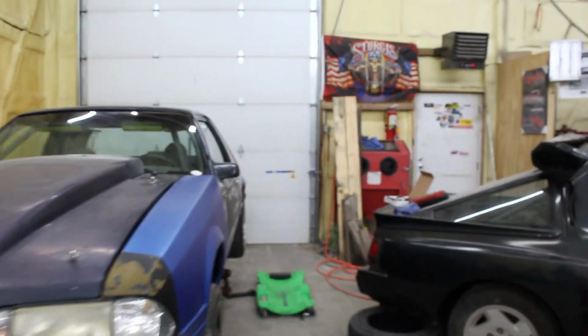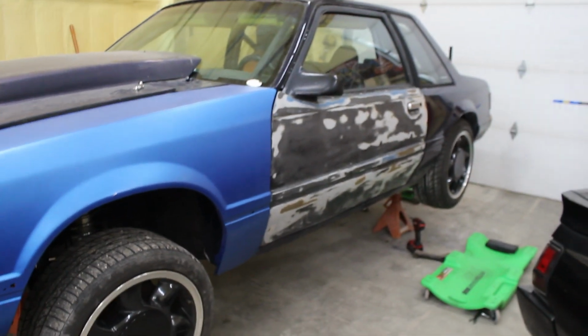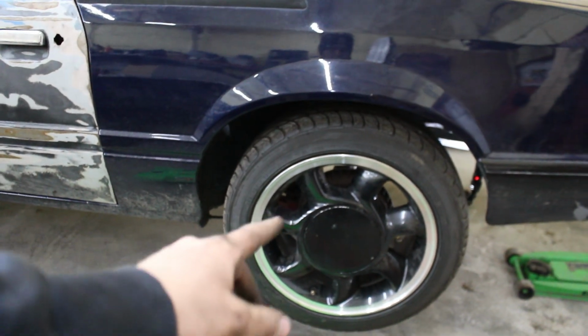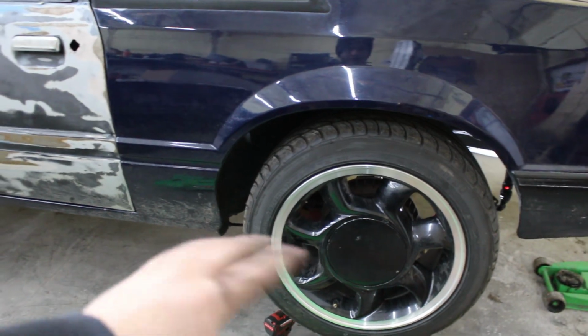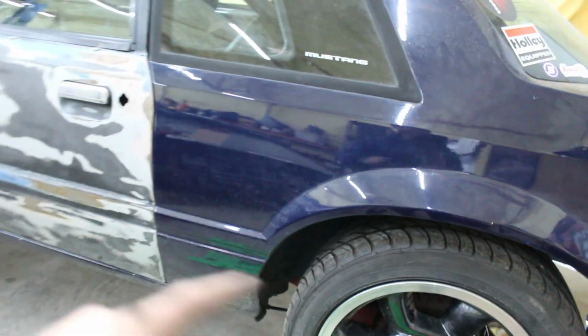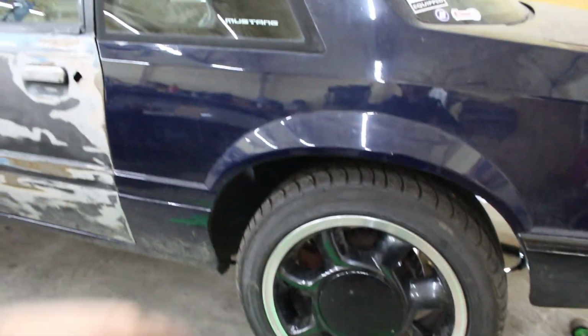Alright, control arms are all in, tightened down, locked in, they're even, and the pinion angle is around 3 degrees, is what I've measured. These lower control arms that I have, the lift bars, South Side Machine, they recommend between 2 and 4 degree pinion angle, and I've already had those drilled and they're locked in, I don't want to move them. So we just used adjustable uppers and got the pinion angle set in. It was incorrect before at a -1 pinion angle, and it would just get worse as you put power down. So hopefully now it'll make a big improvement.